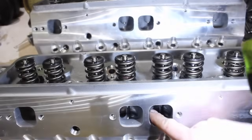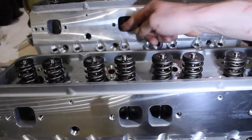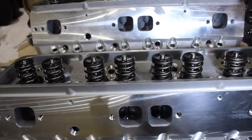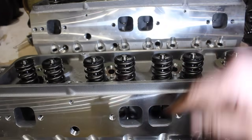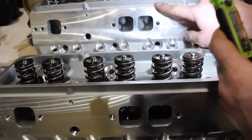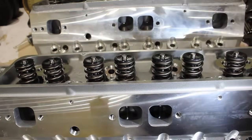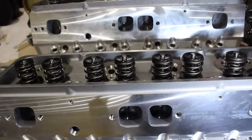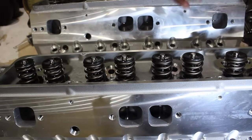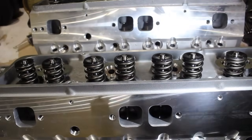Sometimes port alignment can be a little funky with a Vortec intake. Same sort of thing with the exhaust ports — the exhaust ports on the DNA heads are definitely more rough. This is really noticeable on the exhaust. Big slag marks. You can actually see here, even on the front casting, how smooth the AFR is versus the roughness on the DNA. Overall not bad — I've actually seen some other North American heads with worse castings than this. But between the two, the AFR head is definitely better.